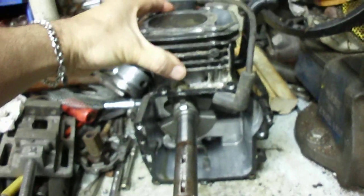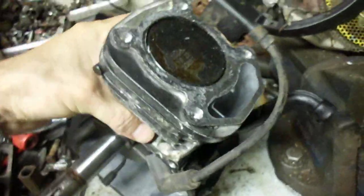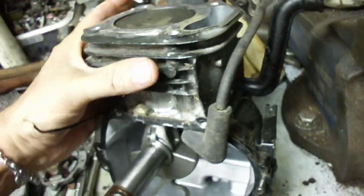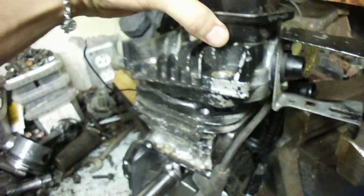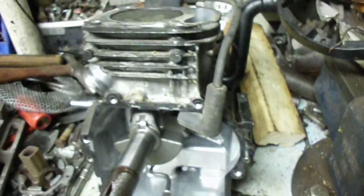My son thought of another solution — instead of setting the engine straight up, what if you tilted it on the side, something like the Animal engine? That helps it drain back, but you'd still need a breather up on the top somewhere other than down low, which would make it even worse. Mounting it on an angle though — I'm suspecting the carburetor would end up on the low side, which is going to cause some carburetor mounting issues.